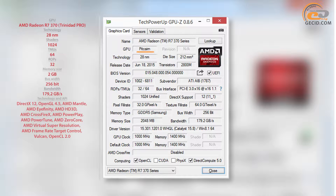It has 1024 stream processors, 32 rasterization units, and 64 texture units. The GPU operating frequency has been increased up to 1000 MHz with respect to the 975 MHz reference. The 2 GB of memory is assembled with 8 Samsung chips, which operate at a recommended effective frequency of 5600 MHz. Data exchange between the graphics processor and the memory is implemented through a 256-bit bus, with bandwidth of a little more than 179 GB per second.